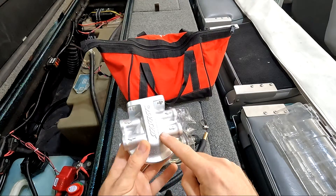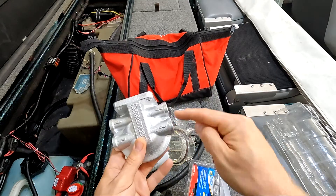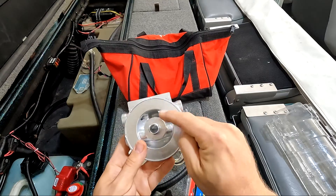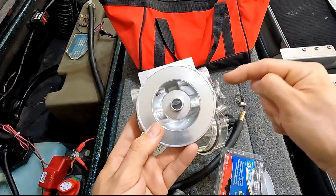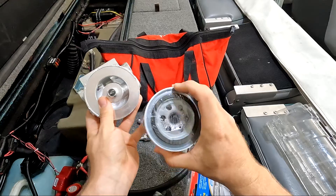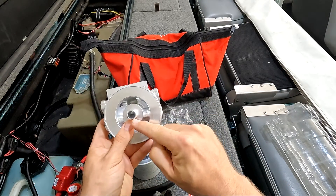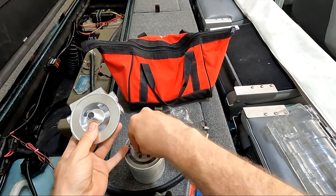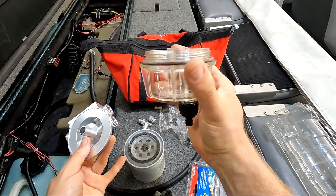There are a couple ways you can run the fuel lines. You can see the arrows on the top — you need to have an inlet hose and an outlet hose, and you can mix and match them depending on where it's dumping the fuel and where it's pushing the fuel out. The inlet lines let the fuel into the filter, which drops it into the holes on the filter itself. The outlet lines pull fuel from the center of the fuel canister, pulling the fuel through the filter element and letting all the water fall down to the bottom of the bowl.